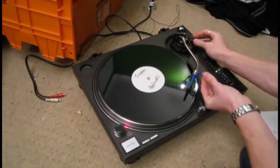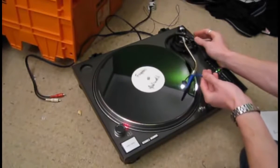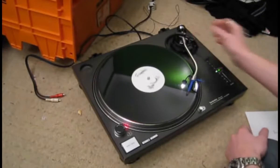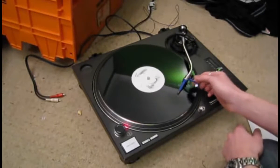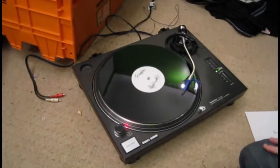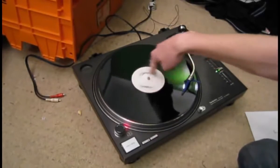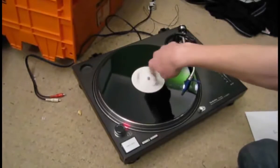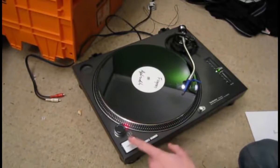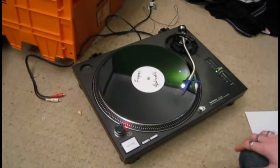What you want to do is just turn it up a little bit and then try it again. If it moves to the centre again, turn it up a little bit more and put it on again. It's going to move to the centre slower each time, and what you eventually want is to be able to put the needle on there and basically it will just stay where you put it — it's not going to move all about all over the place. Even when you spin the vinyl faster, it's not actually going to move from that spot. If the needle doesn't move when you can spin it quite fast, then you've got the anti-skating set properly. Also, you should be able to stop and start it and it shouldn't move from where you've put it. That's how you know whether the anti-skate is actually working.